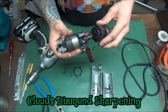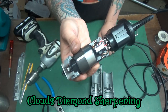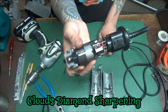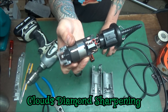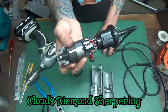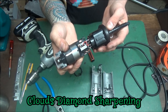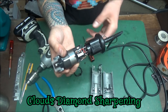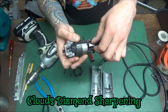Can you test it before we put it all together? It's not alternating in speed — I've never seen it alternating in speed — but basically we conquered every area and aspect of this motor, so it has no choice but to run full speed now. If the problem persists — I doubt it will — but it would be because this is getting hot and one of the diodes is melting off the PC board, then you'll have to replace the cord pack. But as far as the clipper goes, it's perfect — there's nothing wrong with it now, it'll turn on every time.